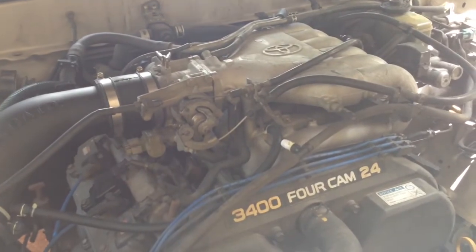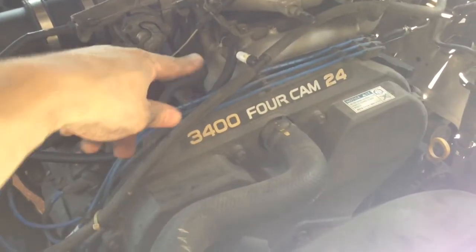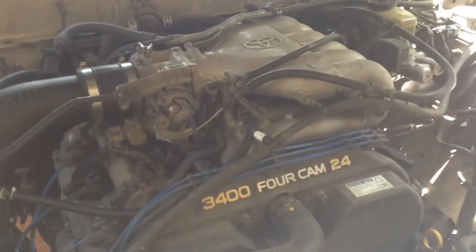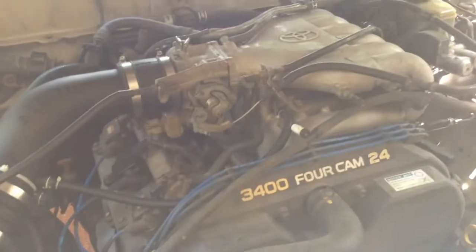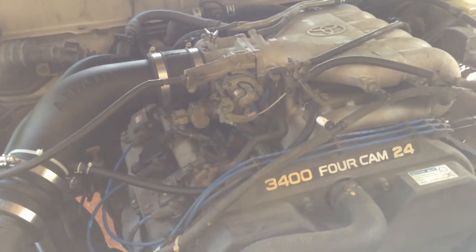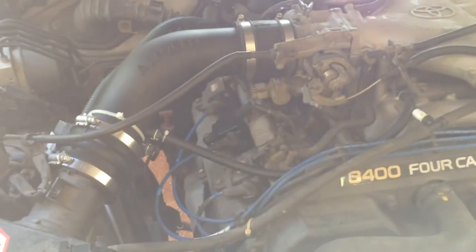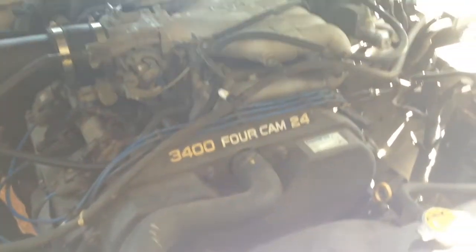We'll start it up and see if it fixes it. It's running smooth — so far so good. I'm going to call that a fix. I just need to replace this hose here since I had spliced it previously. It's running good. I've let it sit and warm up to operating temperature just idling, and so far no miss. I went ahead and left that new coil in there at least until I know for sure the miss is gone, then I might swap it back for the original one. Anyway, thanks for watching.